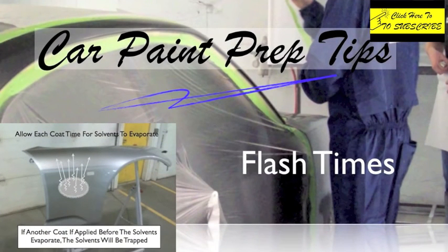So I keep mentioning flash times. I want to expand on that just a little bit to help clear that up. When you spray something on there, it has solvents in it, and that solvent has to evaporate. It has to evaporate out of the surface.